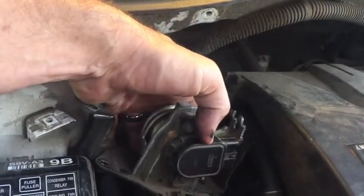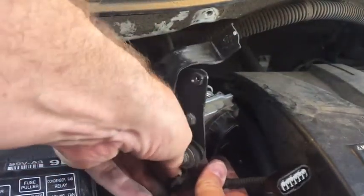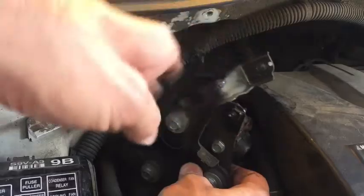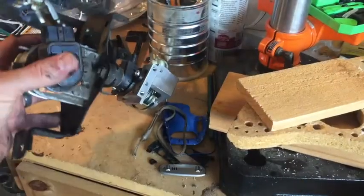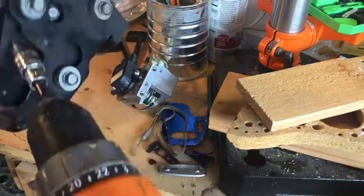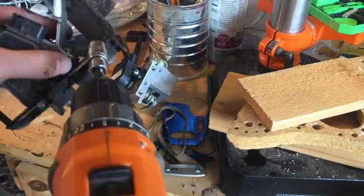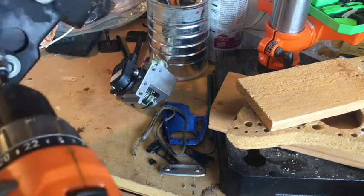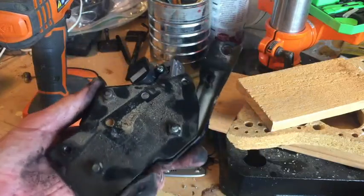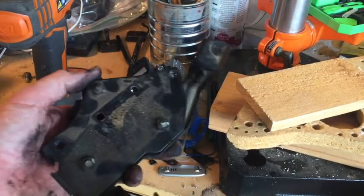And of course we're clamped on right here too, right here at the bottom of the bracket. The actual wire to the sensor is going to be clamped on right there. Let's do the same thing right here. Try not to get dirt inside that plug. There's the old one. If you just take the whole thing and turn it upside down, these two right here are 10 millimeter — we're just going to pull those out and that's where we'll bolt the new one on. These are bushings mounted to the bracket. There's your mounting bracket, nice and dirty, and there's your old accelerator pedal position sensor. I'm going to clean this real quick off camera.